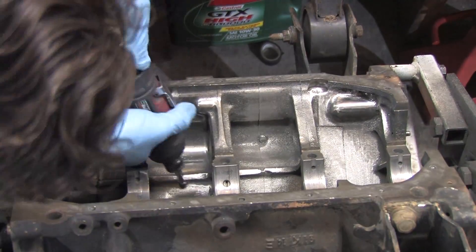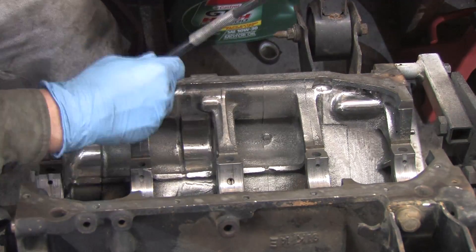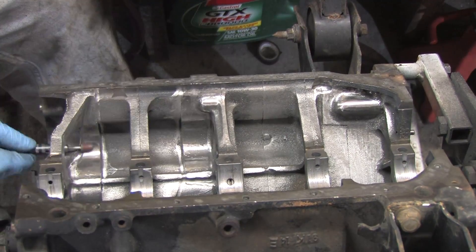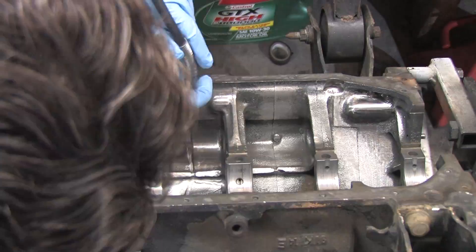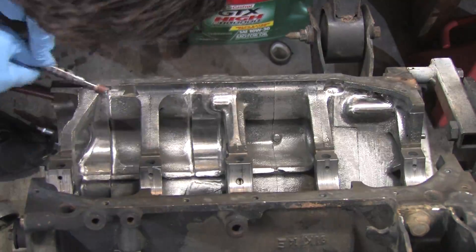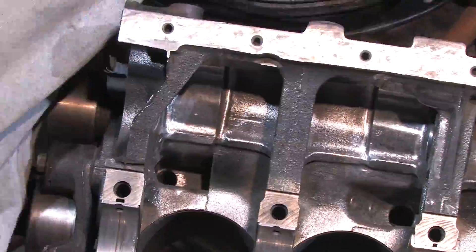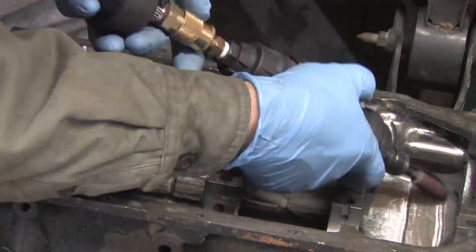Another technique is channeling the block. When you channel the block, you grind shallow grooves in high flow locations in the direction of flow. You should consider thrust angles that would be applied under hard acceleration and how that will affect the drainage. Also consider when your oil pump is spinning at redline and moving its maximum volume of oil — figure out where it's going to flow when it returns. Take out all the rough edge transitions, grind channels in the surface, and give them all a good polish. The polished surface of those channels gives the draining oil greater velocity. It's a good idea to polish all of the surface below the cylinder head's oil drain-back galleries and around the channels themselves.